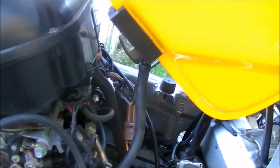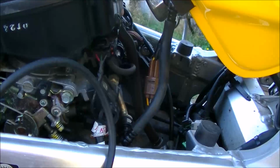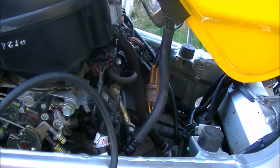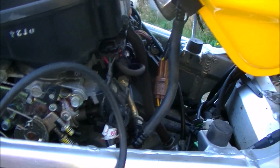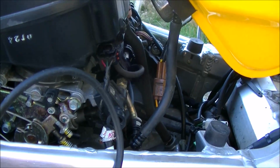Once you do that, you can get in at all the goodies underneath, your injectors, your butterflies, your cables, electronics. Makes the job a lot easier, especially in a case like this where you have to run the engine. You don't have to worry about trying to hang a tank up somewhere. It'll run with the tank right in place.